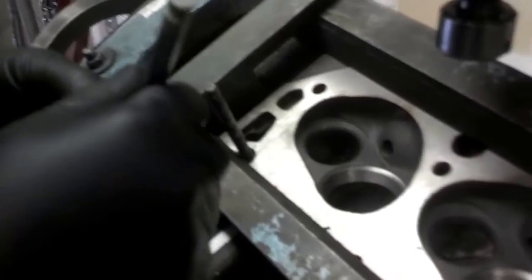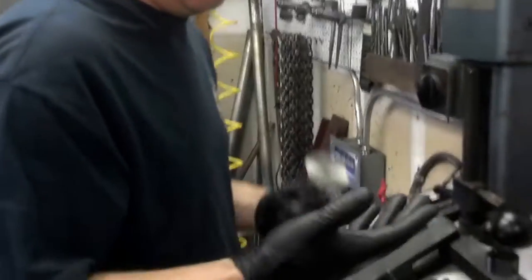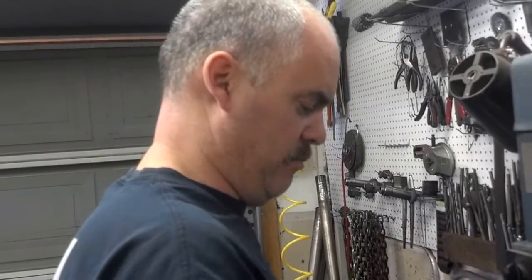Getting the seats modified is something pretty much any machine shop worth their salt can do. I recommend if you're going to use a set of 781s — this engine is going to be a street motor, but this guy is going to run about 11.5 to 12 to 1 compression with dome pistons. It's probably better to go with the 781 or one of the better castings — an open chamber head with a dome piston rather than a closed chamber head with a flat top, because you get more combustion chamber area. If you put bigger valves in and do a little porting, they work great. For those of you who are big block fans, that's how you do it — thanks for watching.